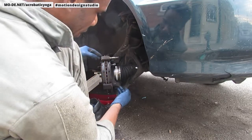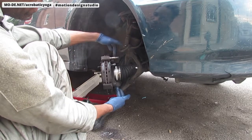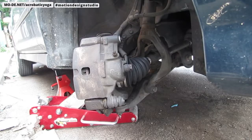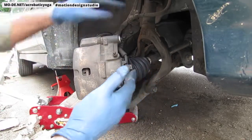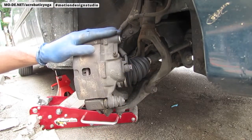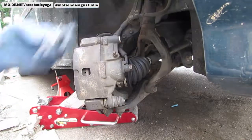I'm going to go ahead and take this to the brake shoes, already ready to go. I'm going to take this bolt off right here, and this bolt right here on the top. Okay, so right here and right here, because I've got to get the brake shoe holder part off. I wanted to back up a little. I placed the caliper back on, right here, like this. I'm going to take this bolt off first. It's going to be a lot easier where the brake line comes in. Try to do it while it's on versus off. The caliper comes off with a 14 millimeter socket.